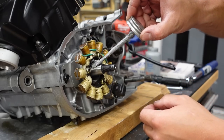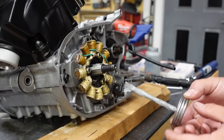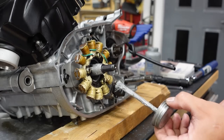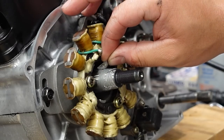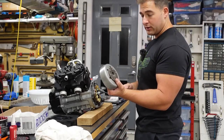The way you adjust the timing is: on the stator plate, you line up the numbers with the seam in the case. Set to zero degrees is stock. I'm going to be setting this to plus four — so the plus four mark is right at that seam. I put a little bit of anti-seize on our tapered shaft. Got our shaft key with anti-seize on there as well. Got a brand new pre-owned OEM flywheel — the one that came off was rattling. Did you know there are people that take aftermarket flywheels and vapor blast or sandblast them to make them look like OEM, then sell them as OEM? Just something to keep in mind.